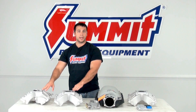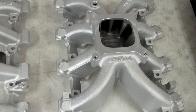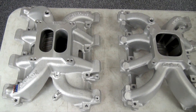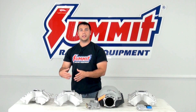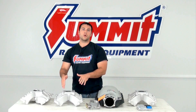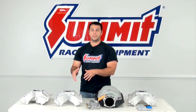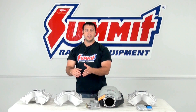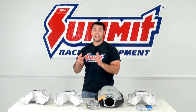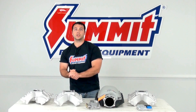With the carbureted setup, you can easily choose a carburetor of the proper size for the displacement and the cam and what you're going to use that vehicle for, as well as a computer box that will run the coil packs that you have. I do recommend that you stick with those coil packs — don't go with a distributor type system. That is an extremely expensive setup. It involves changing out camshafts and installing a distributor, which is a lot of work and a lot of money for little improvement. It gives you the look, but no actual benefits in terms of ignition.